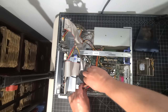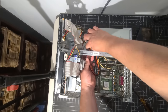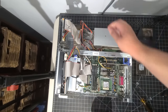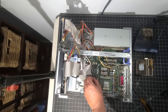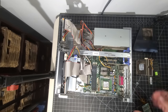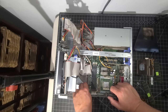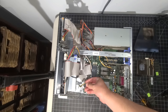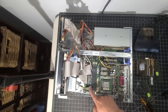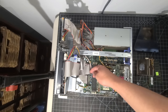Next thing we're going to do is disconnect the ATX power supply connector from the motherboard because it's in the way. We're going to remove the memory — that seems to be the running gag on this channel that Mr. Retro Recall cannot replace memory correctly. We're going to remove the front panel header. I like these because it's literally just a single cable that connects in — your power LED and hard drive LED all go through this, instead of having multiple individual wires.